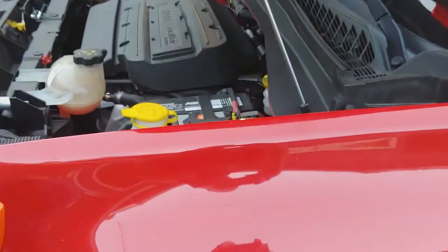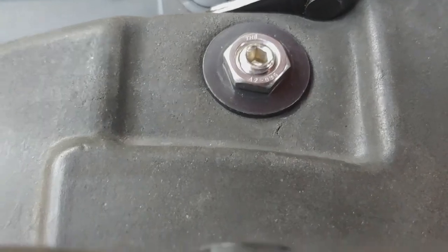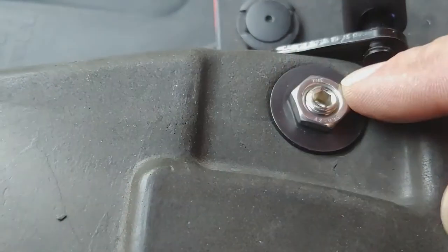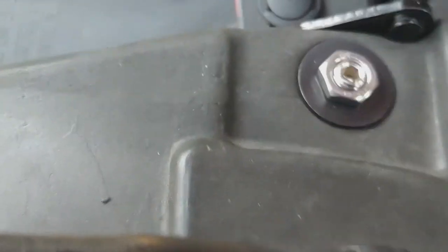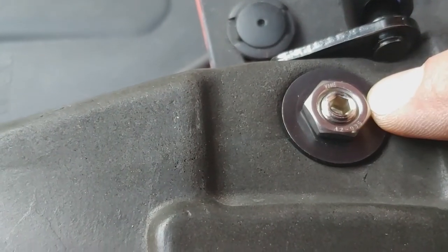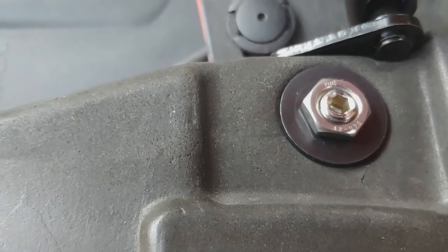Added different bolts and nuts to the lift strut bottom brackets because I didn't like how there was just an open hole in the foam — it wasn't securing the foam anymore. Where there used to be one of these push clips, that hole is now used to secure the bracket underneath the foam for the new lift strut.